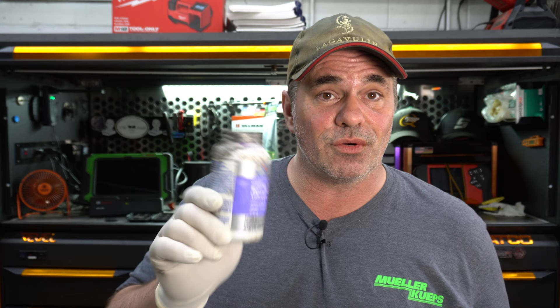I'm the Fly-Rite Master and this is a PSA about using Permatex Ceramic Extreme Brake Parts Lubricant on slide pins — i.e., stop it. This is our go-to lube for pad surfaces so they don't squeak, but do not use it on the caliper slide pins.